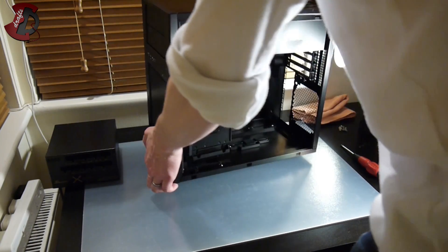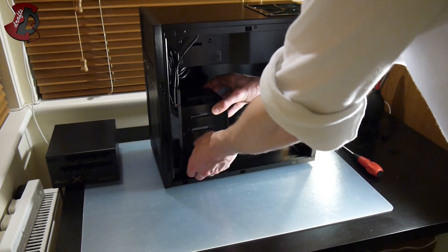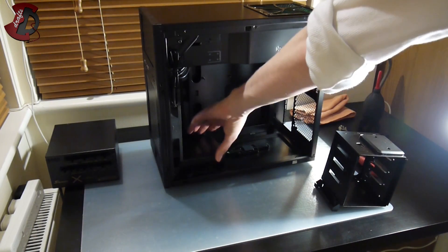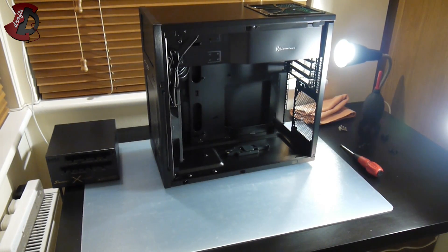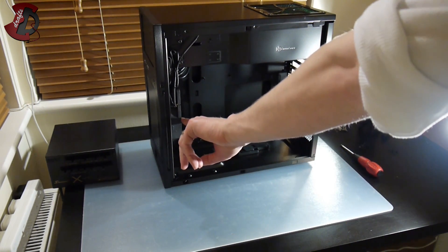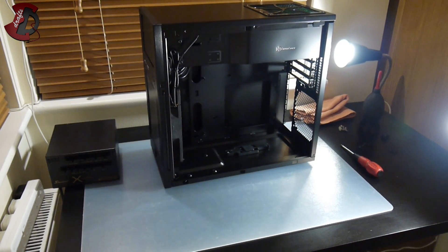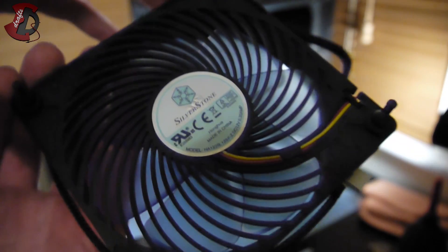So there's the case inside. The screws are already removed. This part comes off — it's simply your hard drive bay. The other one holds your 3.5-inch device, whether that's an old floppy drive or an SD reader. Inside we already have a 180mm fan, and that's where I'm going to install the other fan — a Silverstone Air Penetrator. This one has no LEDs because the case has no window anyway.